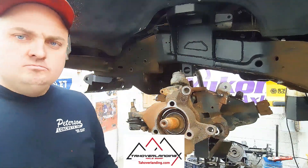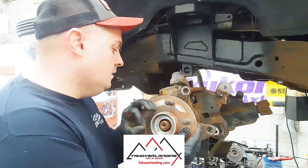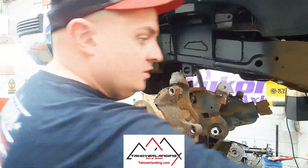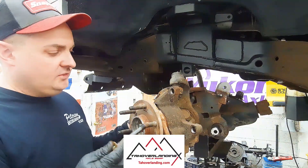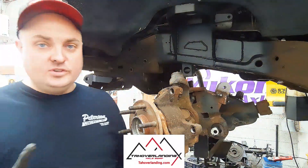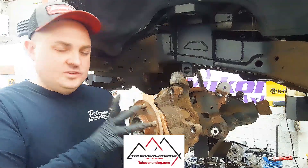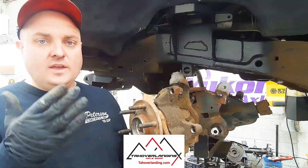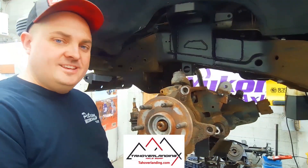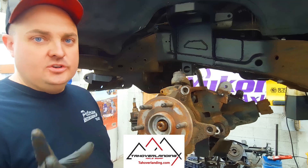It's pretty simple — we're just going to slip this on. We're not even going to put a brake caliper on because we just want to put it under its own weight to check everything. It slides right on, and you have to use the Dodge hub bolt, not the Chevy hub bolt — the Chevy hub bolt is too short. What I really like about the GMT900 hub is that even for mock-up or driving, you don't actually have to have the spindle nut tightened or even in place. This being a GMT400, you will need to use GMT800 brake rotors, which are actually a larger rotor.